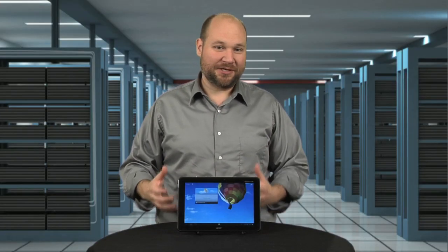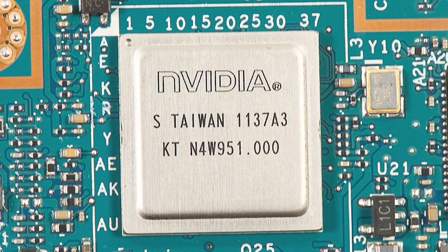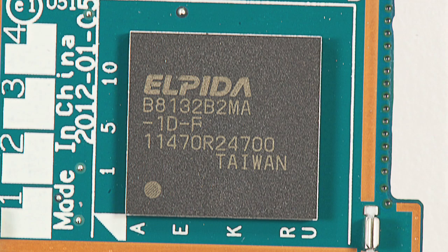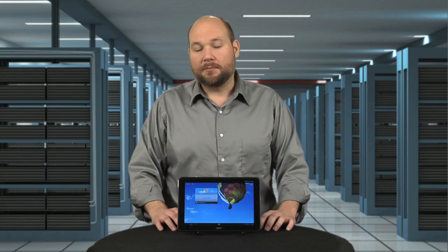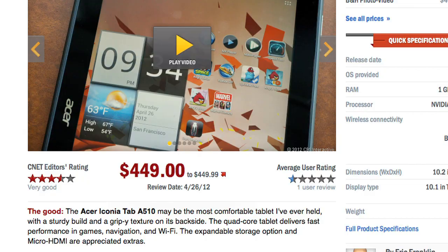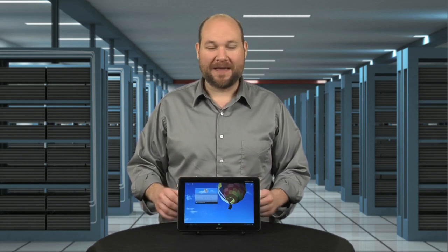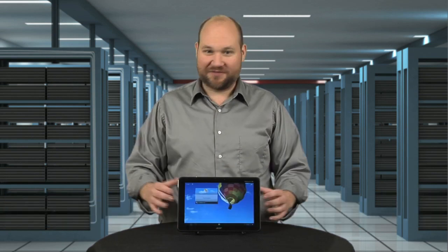Aside from my complaints about its internal design, the A510 is a good tablet with decent hardware. It has a 1.3 gigahertz quad-core NVIDIA Tegra 3 processor, 32 gigs of storage, and 1 gig of RAM, although it's DDR2 instead of the faster DDR3. Its external design may not be super slick or ultra-thin, but as CNET's Eric Franklin wrote, it's one of the most comfortable tablets he's ever held. I only wish that Acer had made it just as comfortable to crack open and repair. To see more teardown photos, check out my full Cracking Open gallery at techrepublic.com/crackingopen. I'm Bill Detweiler — thanks for watching.